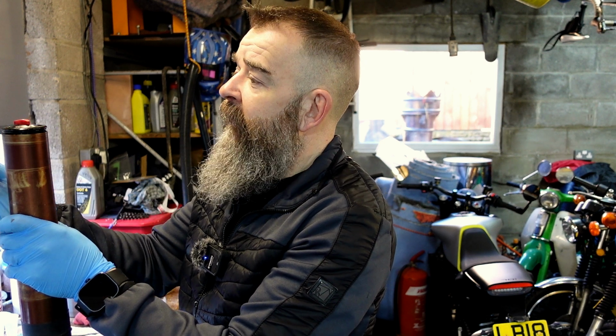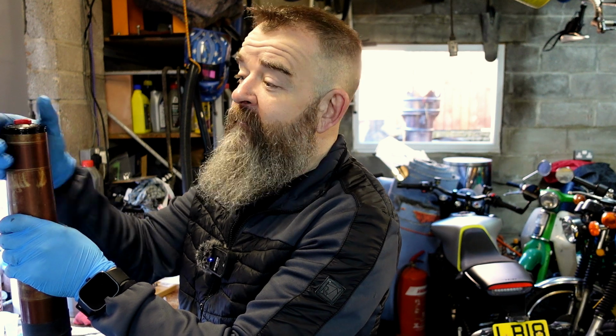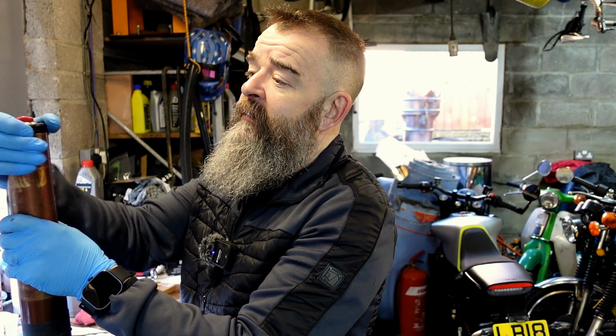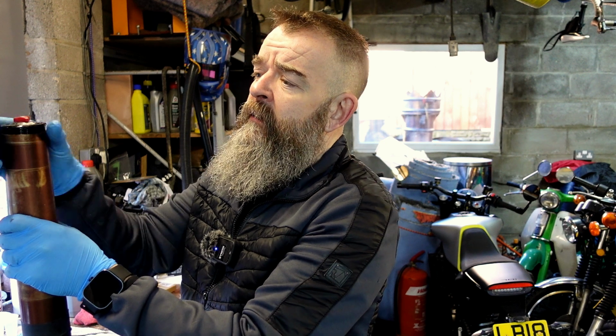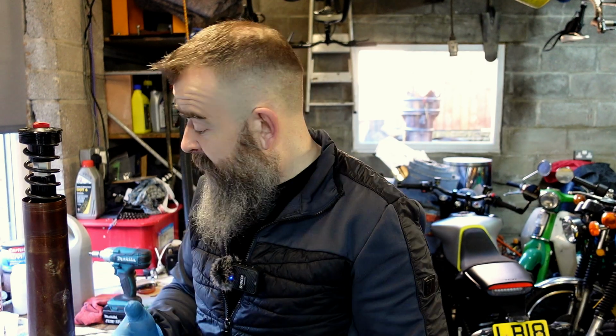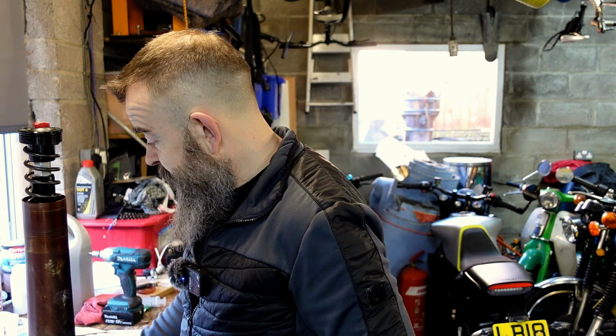If you can hear that, somebody who had this bike before hasn't been bleeding their suspension whilst using it. How many of you lot, when you come back from a ride, take the bleed screws out the top of your forks? Get them automatic bleeders, builds up air pressure because of the friction through going up and down, etc. Fills full of air and can blow your seal. So every time you finish riding, that's what that screw's for. Read your manual, that's what it's for.